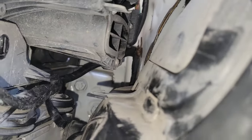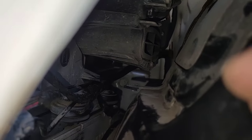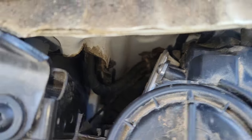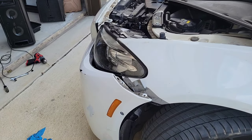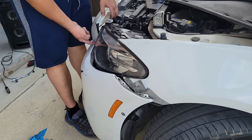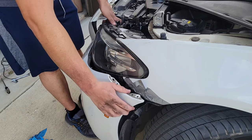This was a hard one. There's one more T30 — this one was a pain. It's way in the back. The only way I was able to see it was by shining a light through here, and I could see the bolt. That took me about an hour to remove. But once that's done, it should start to slide now — and yeah, it's starting to slide.